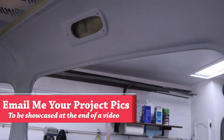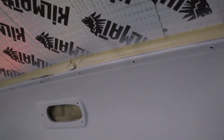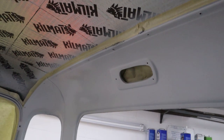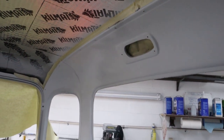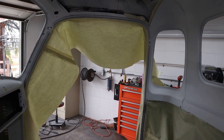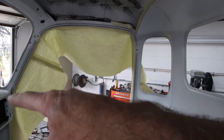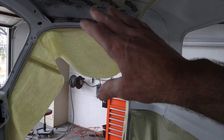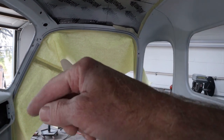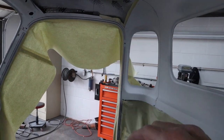Mostly that masking is to keep any dirt from blowing out from behind there. Up here where the dome light goes, I've got some paper back in there. And also up here, I've sealed that lip to the kill mat because there's some old crappy insulation back up in there and it will blow out when I'm spraying. So I want to seal that up really nice. And then I masked around the door jam there — that rubber piece that goes all the way around, covering where the headliner is and all the way down to the A-pillar. I'm masking to that around the corner, so that'll be black.